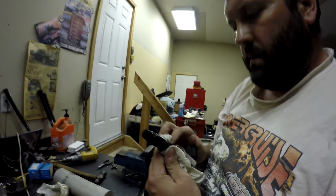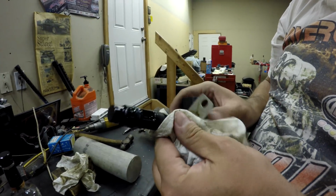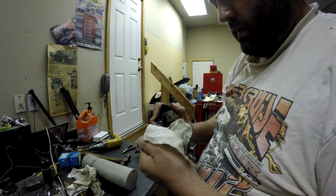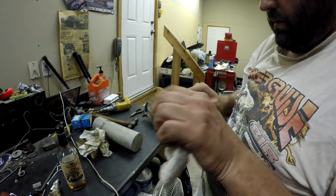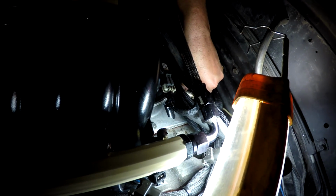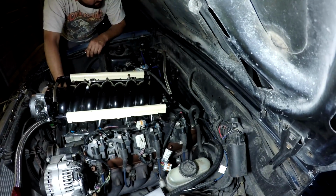There's an O-ring on it. I mean, there's oil on this side of the O-ring. See how it's wet there? That does look like some oil was shooting through. Is that supposed to be dry? Probably, well, past the O-ring, yeah, you'd assume. There's an opening in the back of the block, and about half the middle of that sensor is exposed. It engages good, and it seems like the cam sensor is an issue here.